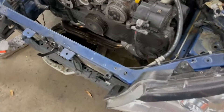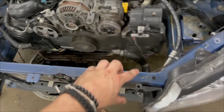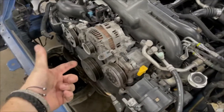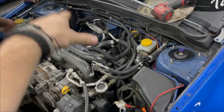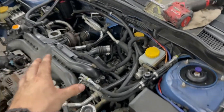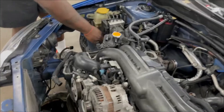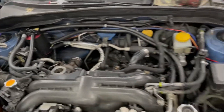As you can see, we move really quick. Drain the coolant, take the upper and lower radiator hose off. You'll have the bracket here and bracket here, and then you'll pretty much be able to snap that off. On the belts, I went ahead and cut the belts — who cares, I'm putting new ones on anyway. AOS and all that stuff is either still on the AOS itself, or I left the hoses on the motor so we can just pull it out with it. Most of the harness is unplugged — we're moving pretty fast here.